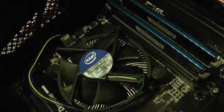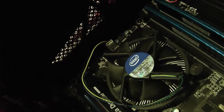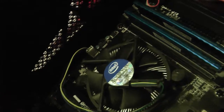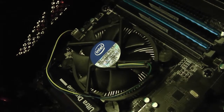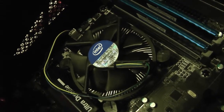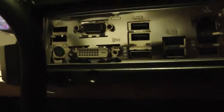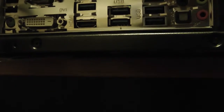I'm now going to get myself a cup of coffee. You will notice I've not put the graphics card or anything else in - that's fine. I'm going to have a cup of coffee and then come back to this. We've got to plug everything in, we've got a graphics card to fit, a wireless card to fit, and it should then be a case of switching it on and installing a copy of Windows 7. There are the connectors at the back of the motherboard - USB 3, USB 2, HDMI, video out etc. We're not going to use the video out features on here as I've got a dedicated graphics card which we are going to be using.